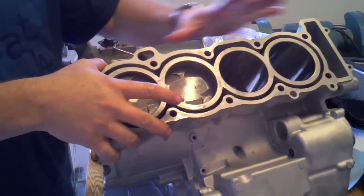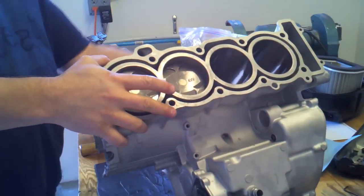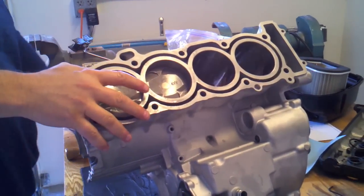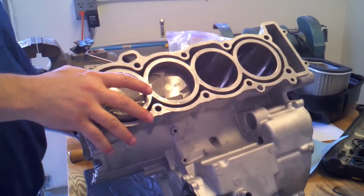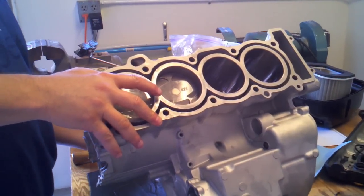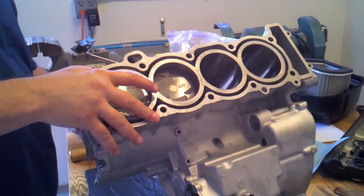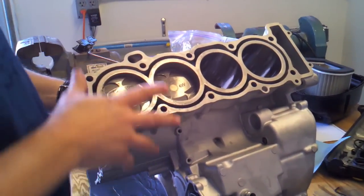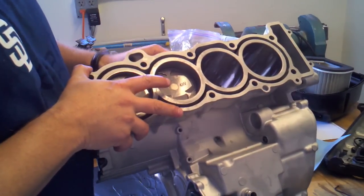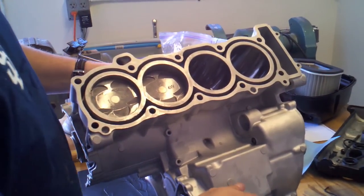As you can see, I have my crankcase tilted up so I get better leverage. The crankshaft itself is sitting over on my workbench — I don't have it here. What I'll do next is remove all the tape and then go ahead and get that crankshaft down onto these journals and then tighten up all the connection rod caps. That's the procedure to get your pistons into their newly plated bores.